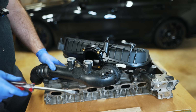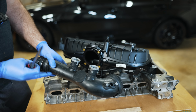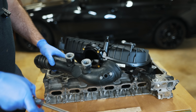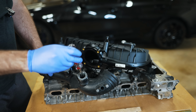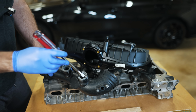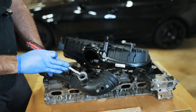All right, this will be a little strange analogy, but assuming this is the air intake, not the charge pipe, it's on the other end, you have a filter and it's sucking air in. Imagine you heated up this screwdriver and made it red hot and then you put it into this port here as air is blowing by it, and it's going to naturally get cooled off by the air. If you were to measure how fast it cools off via voltage, that would be your mass airflow. How fast do you overcome the heat on here? And that's how it's going to adjust airflow.